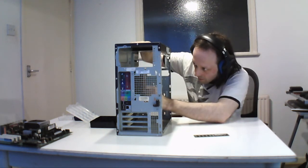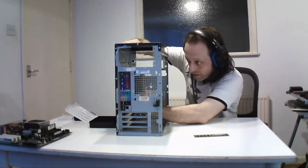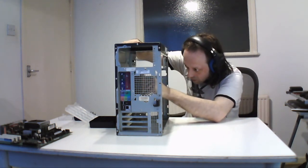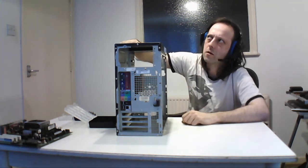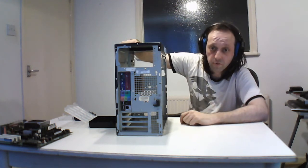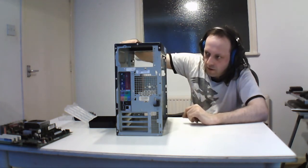And the thing is, older RAM is a bit more... You can still buy older RAM, but sometimes it can be expensive, and it depends where you get it from. But you can still get them to upgrade old machines. Just put this in here for now, so we don't lose them. Yeah, DDR1 is on this. Also, it's probably only limited to 2 gigs because it's rare to find a 2 gig DDR module. Yeah, but no, they've had a GPU card. This would be good for a test system, but no. Also, it's only 32-bit as well, so it has limitations. Yeah. So that's that one.